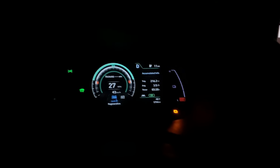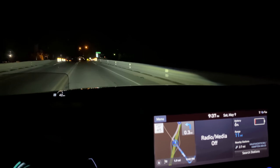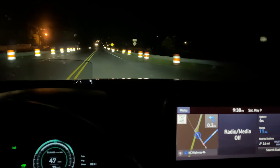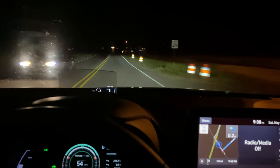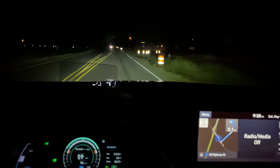Let's drive up and down the access road, and then we'll drive around the track once it really starts to get low. We already have the battery light on, and sometime around 3% to 5% — depending on battery temperature — turtle mode kicks on and we get a real limitation. So when turtle mode kicks on, I'm definitely going to head towards the track. I think we can do about 55 to 60 miles an hour through here, maybe a little bit more.